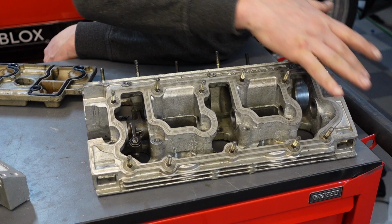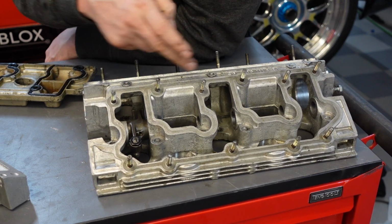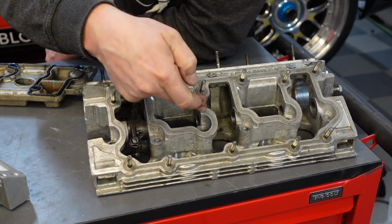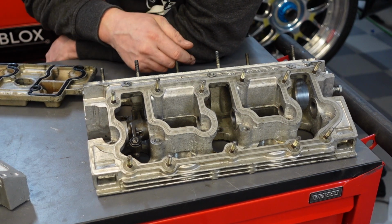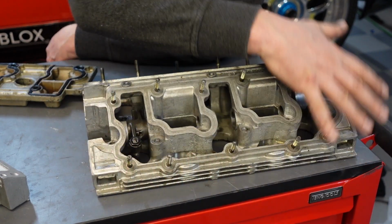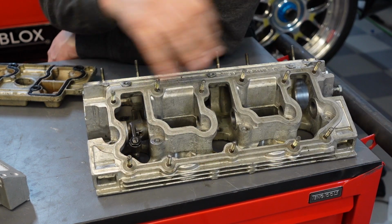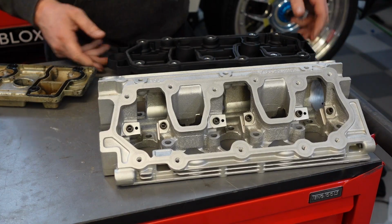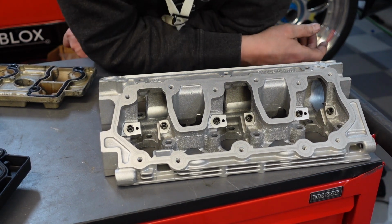So that means just this compartment here, how many places is it exposed to the outside? Well, the big seal here, so that's 1, 2, 3, 4, 5, 6, 7, and then we have between the heads and the engine 3 more. So 10 different places do you have a sealing perimeter on this compartment alone. 10 places. In the 993, they obviously put a little bit more thought into this.